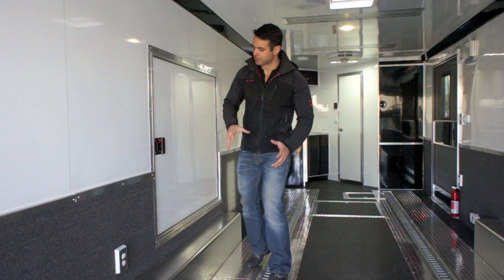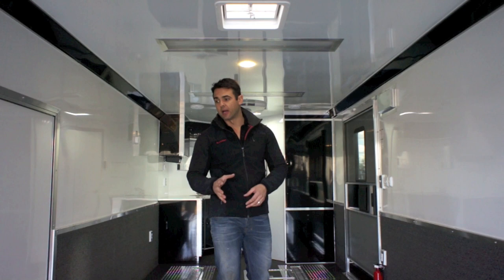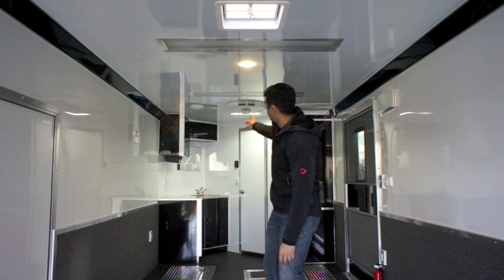Here's a look at what the escape door looks like from the inside — you pull your car in and simply open up your RV-style escape door. There's a 110-volt receptacle, and throughout the trailer we've got several of those. We have a combination of 110-volt and 12-volt electrical. The 110-volt package powers your receptacles, fluorescent lights recessed into the ceiling, and the air conditioning unit. The 12-volt system runs off a battery and converter and powers the recessed LED lights and the stereo system up front.